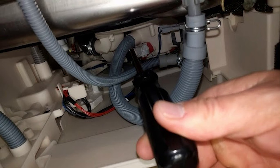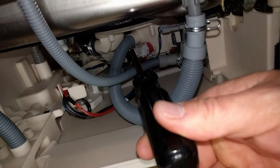Having been around the block a few times, I can tell you: if the water's barely making its way into your appliance, chances are there's something blocking your home's pipes or there's an obstruction in the dishwasher's water supply system. A simple peek and some basic checks can tell you if you've hit the jackpot. First things first, turn off the water supply — the last thing you want is to flood your kitchen. Once that's done, carefully detach the water supply hose from the inlet valve. Then get a bowl or direct the hose over your sink and turn on the water supply. Check for two things: one, is it clear and free of debris? Two, is the water pressure sufficient? When you have low pressure and a lot of debris, it could indicate a clog somewhere along the line. However, low pressure without debris could indicate a kink or a major leak in the water supply system, and kinks are often the most common culprits.